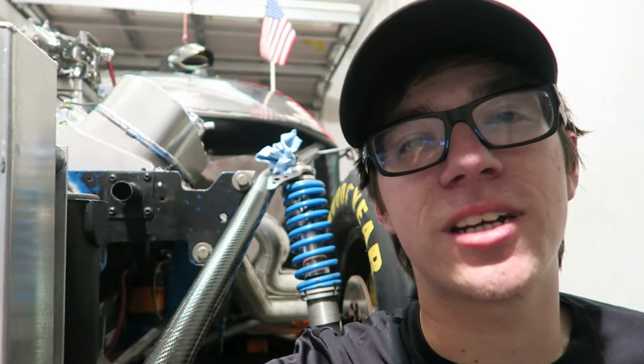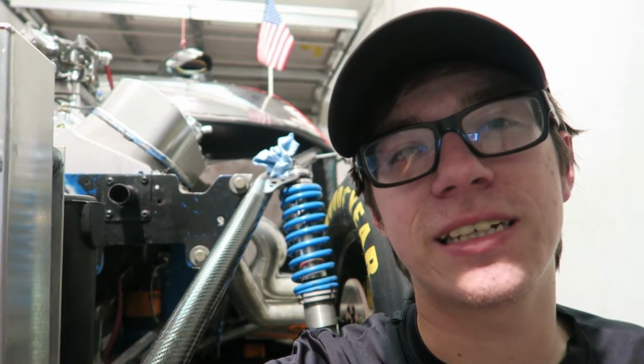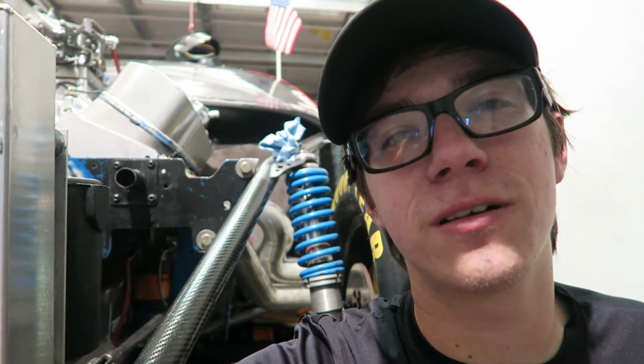The fuel pump now leaks, which we could buy a new gasket set for, which I didn't know with these Magna fuel pumps, that if you let them sit, the gaskets would shrink up. Significant shrinkage. Tried to let it run to get the gaskets to swell up with fuel in it, but it wasn't working. So might as well just go buy a new set of gaskets and alleviate that problem.